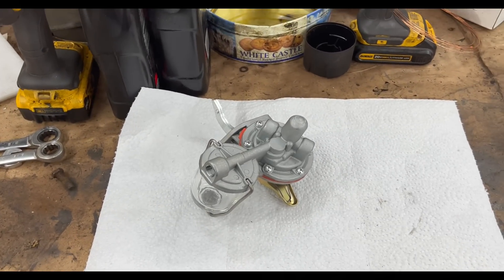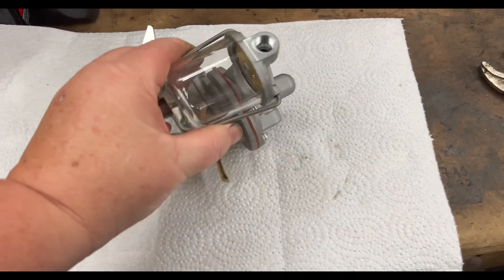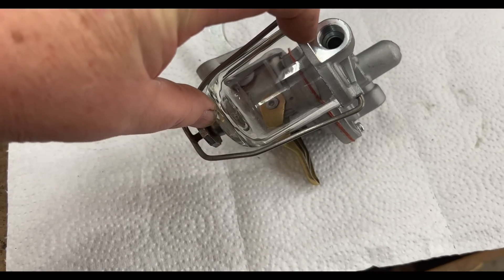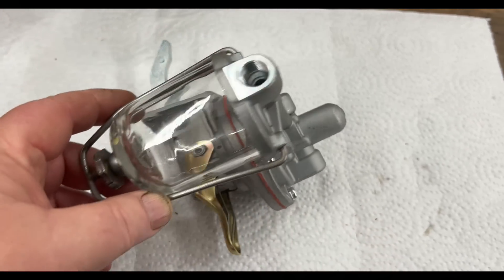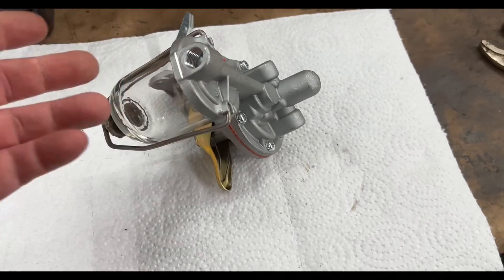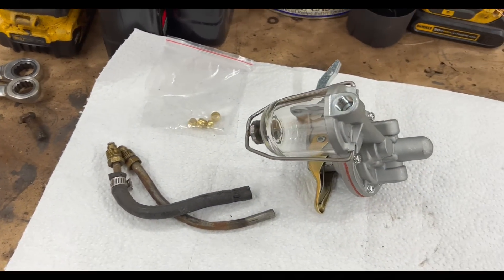Friday at the Rusty Beauties shop. I got this reproduction pump from China and decided to swap out a few components: I've used the brass screen and glass bowl from an original pump. The Chinese bowl is actually a little bit shorter, so you can't use the old style fastener, so I've gone to the old bowl, old fastener, and old gasket to make this work. Slightly modified, but it'll work better. We have a couple of pumps as spares and will carry one in the boot for backup.